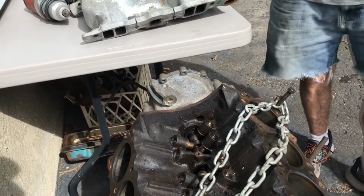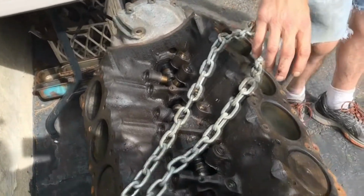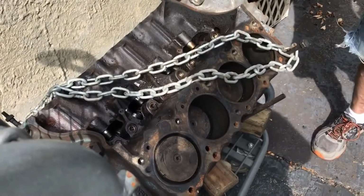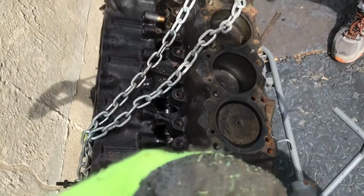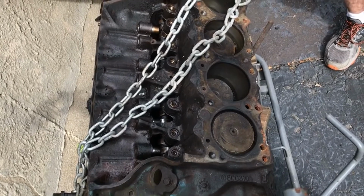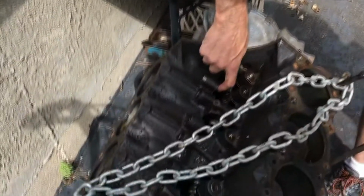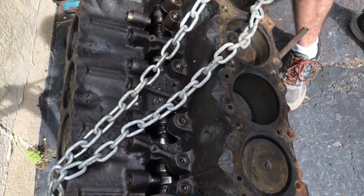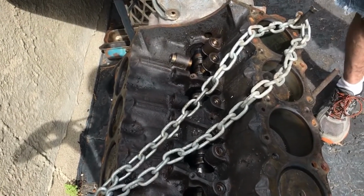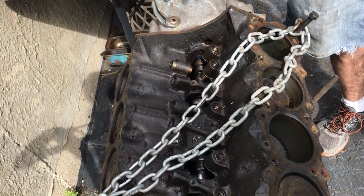Being you're in there this way, I would recommend you could probably get a full set. I got a Lunati Bracket Master 2 on my other engine, and it was sweet. But now, the bigger the bore, meaning like a 350, 400, the 428, 421 gets bigger as it goes. The larger the cubic inch, the cam is more mellower. So if you take like a 285 duration with a 310 lift, meaning how high this lobe goes, how much it pushes that lifter up and pushes the rod to open the valve, you could take that cam and put it in the 350, and you take it and put it in 400, it'd be smoother. Because it absorbs it. There's really no parameters. You could put what you want in it.